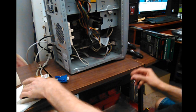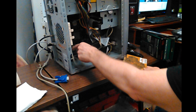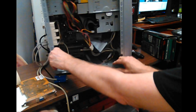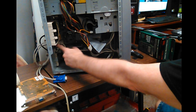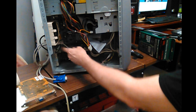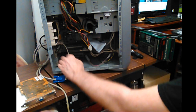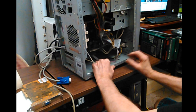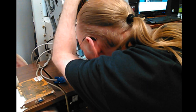Yeah, but that big old, I don't know if you can see that in the video, I'm about to lose my mic, that big old audio, it looks like a quarter inch audio jack, female, for just a regular cable, but it screws up to that little eighth inch audio. Evidently it's audio. If I could see the board good enough down there, I could tell. Speaker out, so it's not like a line output, it's speaker out.